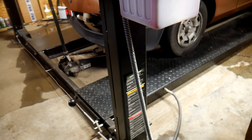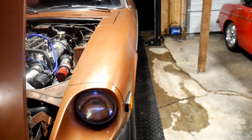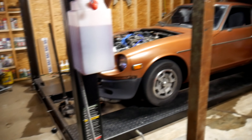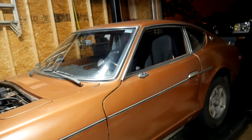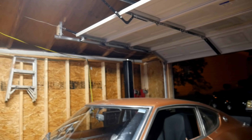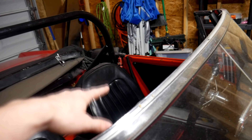I really do love this lift — I haven't had any major complaints about it. I actually got it on a trade: I did a bunch of work for a really nice guy, and he ended up trading me the lift for all the work I did on his vehicle. Another question to ask yourself when thinking about getting a lift is how big is the thing you're going to be lifting. If it's going to be anything over about 3,500 to 4,000 pounds, you should really bolt your lift down. On top of that, how high is your ceiling? That's going to be another big factor.